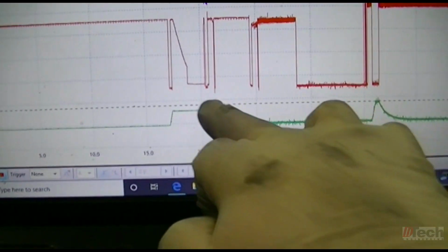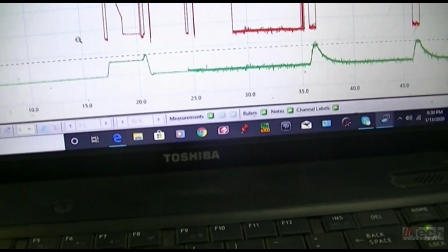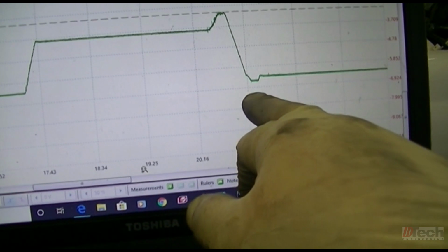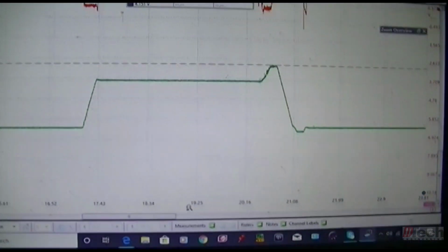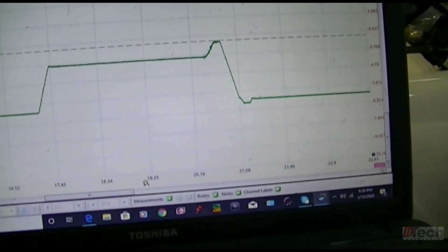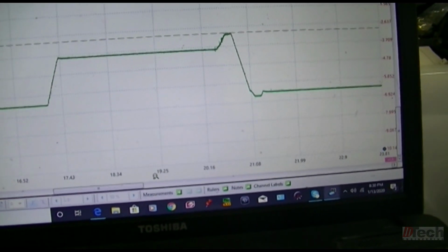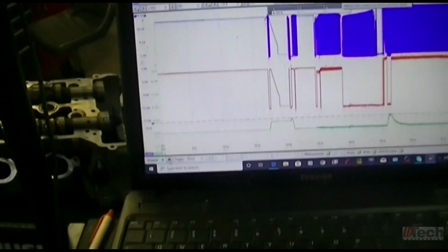And like I said, the dead giveaway was here at this point during the flight check, where the voltage that it reached fully extended was at a lower voltage point because it extended further as opposed to up here. So definitely 100% visually confirmed also with before and after of simply just relocating the clamp. Able to see that is all that it was. It just fully wasn't able to travel all the way, and you can see it with the voltage readings.